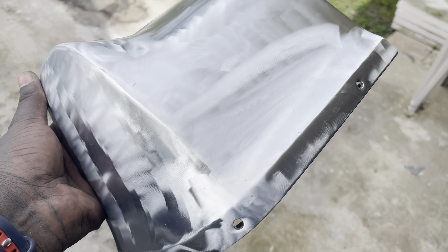I'm using a two-inch buffing pad with the same Ryobi angle grinder, and as you can see, it's shiny as ever. This is pot metal, and it actually resembles anything that I would say would be chrome plated. I got a good outcome as far as the shine. I'm wiping it down to remove the fingerprints. It does have very slight marks of streaking, which I can probably give more attention to with a bit more buffing with the Mother's compound I used to achieve this. But as you can see, it's pot metal, but it resembles the shine of the bumpers, and I'm very happy with that.